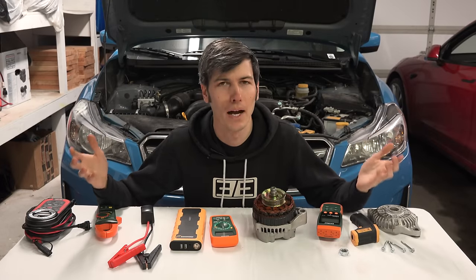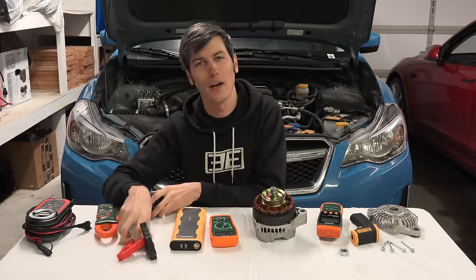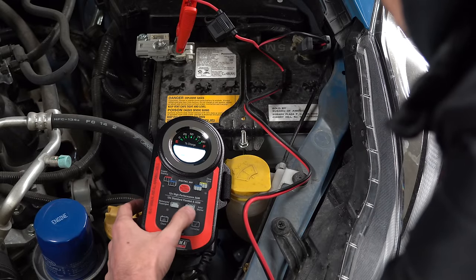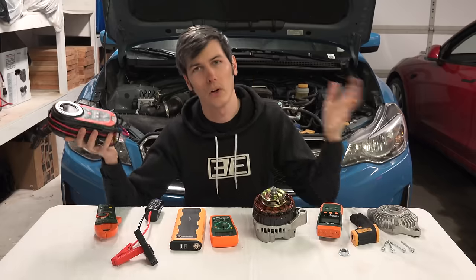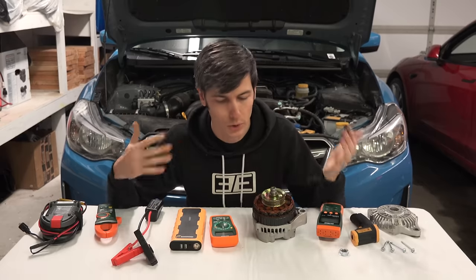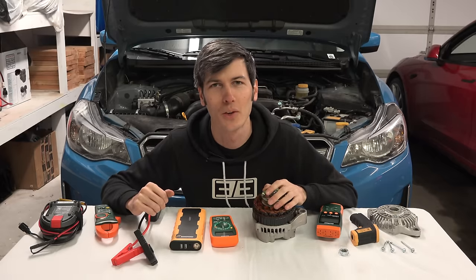So what would my recommendation be? If you're stranded with a dead battery, obviously the smart thing is to jump it and get where you need to go. But if you have a car at home with a dead battery and the ability to charge it — say you left an accessory light on, or have a project car that sits for months — a better solution is to charge the battery first so you don't overwork your alternator the moment the engine starts. Either way, it didn't seem like a huge deal for my Crosstrek to charge back up, though it could be worse with a battery in poor condition. Thanks to RetailMeNot for sponsoring, and thanks for watching!